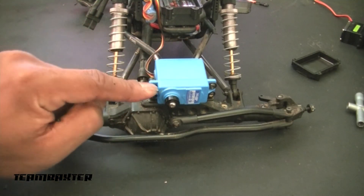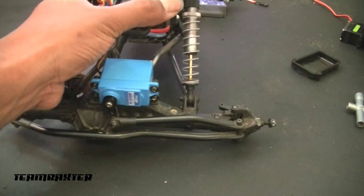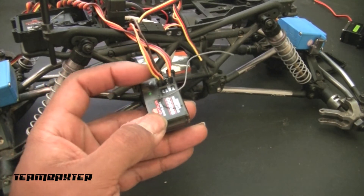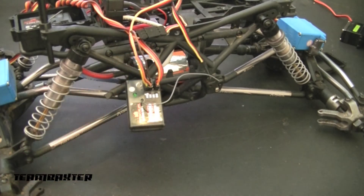In order to accommodate not reversing the rear servo, I've had to figure out how to program my DX3 to rear steer, which is pretty neat and I'm anxious to get that working. That requires me to install the SR300. I enable mixing on my radio for the auxiliary channel, and that way I can plug one servo into the auxiliary channel and the other into the regular steering channel. Since my radio only has a two-position switch, I just flip the servo into the different steering mode with the auxiliary reverse switch on the screen.